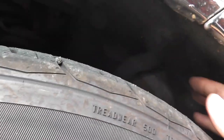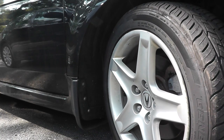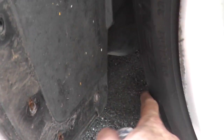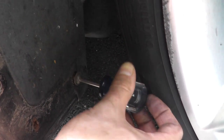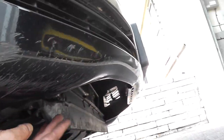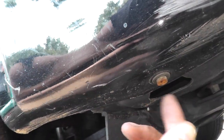Moving over to the side, you have the parking light and the turn signal. To replace these, on most vehicles you have to remove the inner fender. Let me turn on the car, rotate the wheel, and we'll start by removing the screws. The bottom one — the tire is so close to it — but if you have a small enough Phillips head you'll be able to get it. If you don't have anything small enough, you'll need to remove the wheel. Underneath the front bumper there's a 10mm bolt you have to remove, and another one coming toward the front.